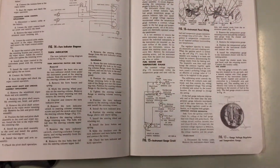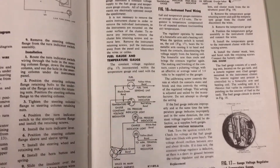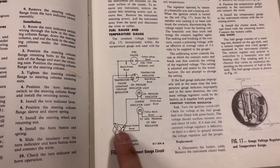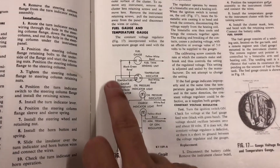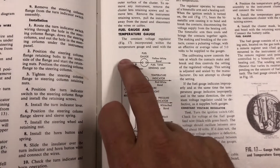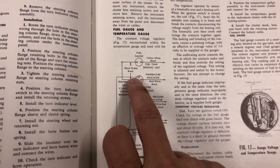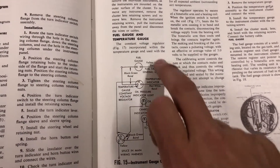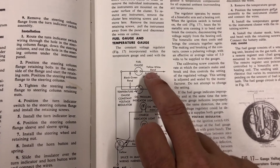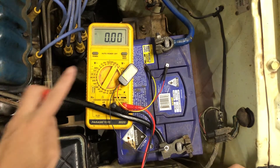Just confirming what I'm saying with the original Falcon shop manual from 1960. We're on the instrument section of the manual — we've got a wiring diagram here. The main wiring harness clearly has 12 volts coming up to the temperature gauge, then there's the loop wire I'm talking about that carries the 5 volts, and then the wires coming from the sender units for both the temperature and the fuel gauge.